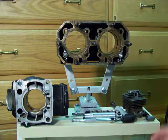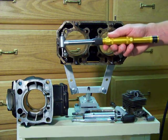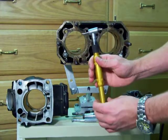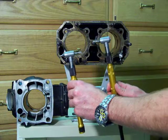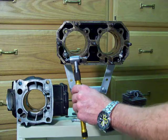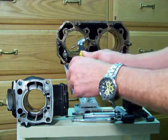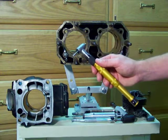The 1MC — I'm going to go over a couple of the quick features here. You'll see this 1MC is in extended mode, which means the head will actually extend three inches to reach better. You can slide it back down and tighten the knurled nut there. The other thing is this is in left-hand configuration, which means the carbide burr is oriented the other way, with a left-hand carbide burr, so the cut goes the opposite direction. What's great about that is reverse and contra angles — you can get in there and get a better angle on the porting tool.